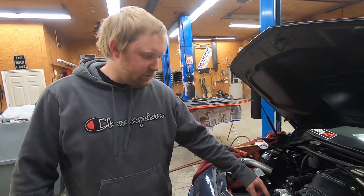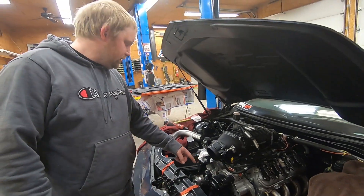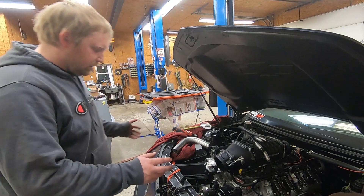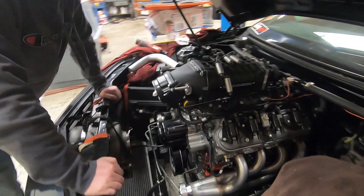We got the new ends welded on — we welded the two-and-a-half-inch V-bands on each header. I just tacked them; I don't have foil down here to back purge them, so we'll do that another day. Just getting them tacked on to get an idea of where to run the pipes and everything. While I was tacking everything, Ryan clearanced the motor mounts — you can see the aluminum just everywhere. That thing makes a mess.